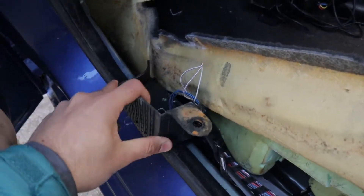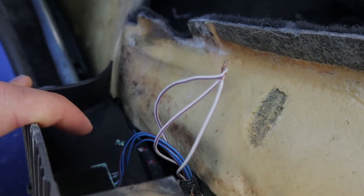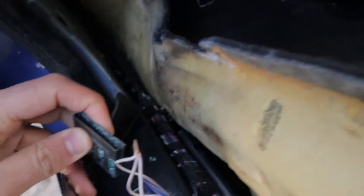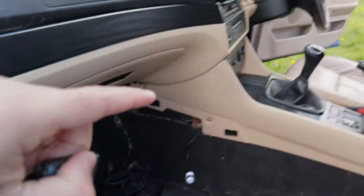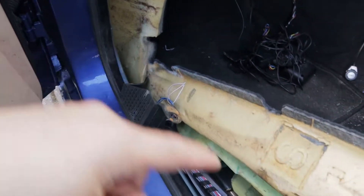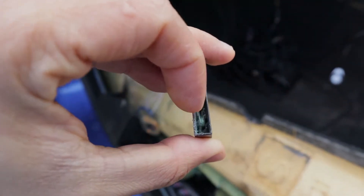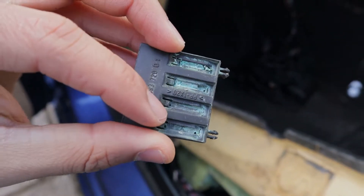This is the culprit — this is what you're looking for. As you can see, there are three white wires with a kind of purple stripe joined together. This connector is usually tied up somewhere around here. Basically, one or two wires come from your OBD port or instrument cluster over to this side, and they go into all the modules. All three wires are meant to be connected together using this connector via a metal plate — but as you can see, it's badly corroded and they were not connecting.